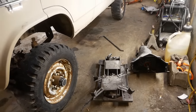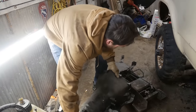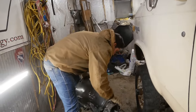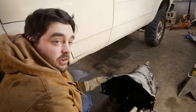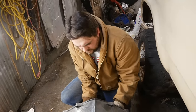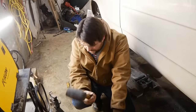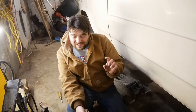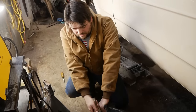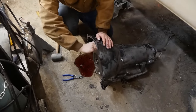Pick up that transmission, let's put it on the transmission jack. It's just a Turbo 350. The key is to lift with your lower back. You gotta put the torque converter in it - Jay from Irish Outlaw Garage had his guy rebuild this for me, so check out Jay. I'm having a hell of a time putting this torque converter in. Don't ever do this, but sometimes the splines on a reman are just not quite right. If you just hit it with a rubber mallet, if you're pretty sure it's lined up, just tap on it around the edge - don't hit it hard, just enough. You know it's installed when you can't get your fingers behind it.